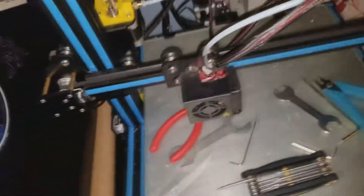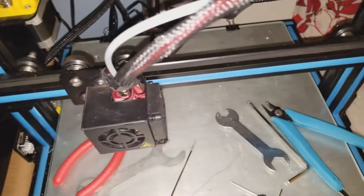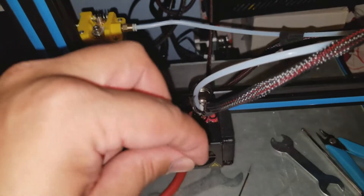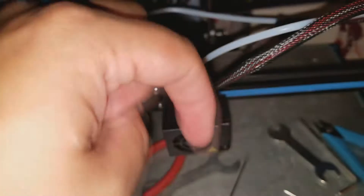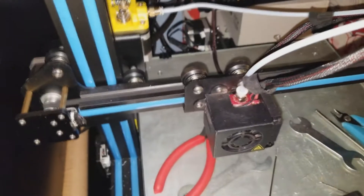What you want to do is take one of these light cleaning wires and shove it in there. But what you could also do is take actual filament - if you don't do it correctly you might really mess it up, so I prefer you use one of these copper wire tools. With the filament, go in a little and exactly when you feel it melting, pull it back up. You're gonna see a lot of gunk comes out because it's on the surrounding part of the nozzle.